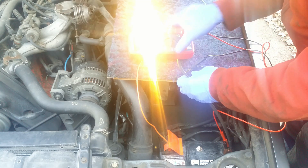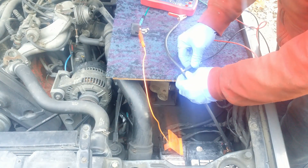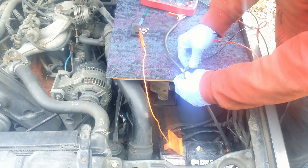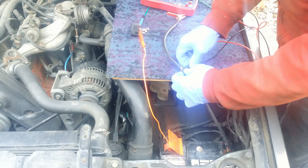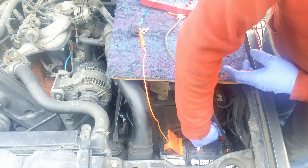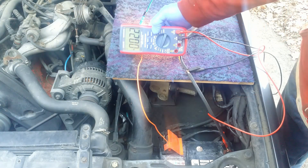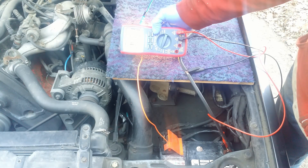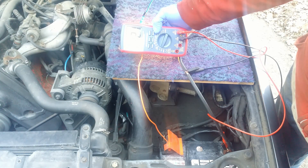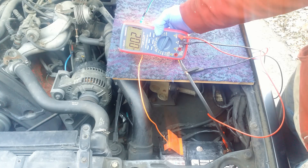Now I will remove part of the insulation from this point. The copper wire is exposed at this specific point. Let's check it again — this time you will see. I read 2.1 millivolts drop on this wire distance. My shunt is gauged.